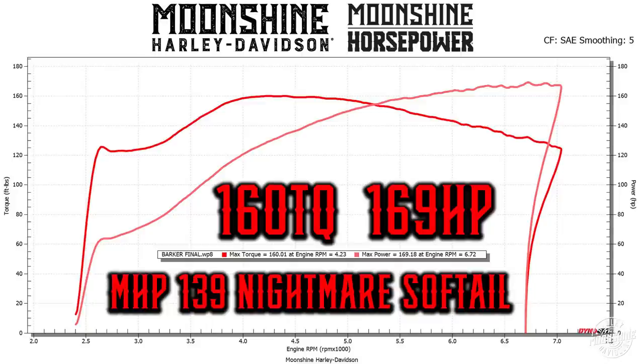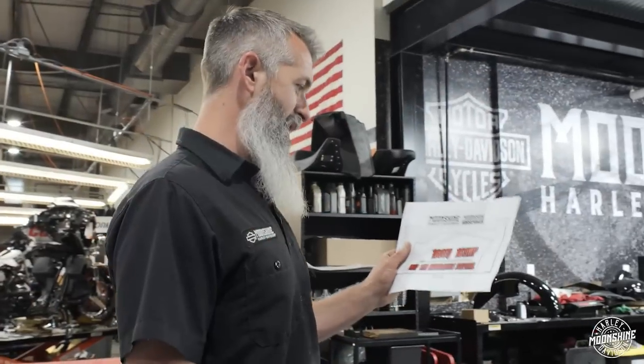The bike from 35 mph on is a complete beast. With a short pipe on a soft tail, you're always going to have that slight dip because it's just a shorter exhaust. We usually don't make as much horsepower with a soft tail as we would a touring bike — several reasons. We need exhaust volume. The second reason is we have two balancers inside the motor swinging, which is putting those balancers through oil — more weight, more reciprocating mass. So little different graphs on soft tails than on touring bikes, but impressive bike to ride. This thing is a complete monster. Even though it doesn't say 180 horsepower, being a couple hundred pounds lighter it'll run down those 180 horsepower baggers pretty easily.